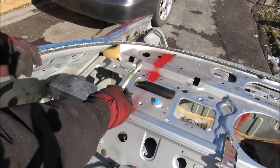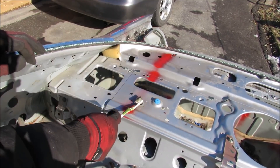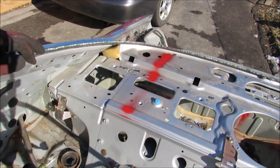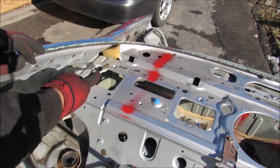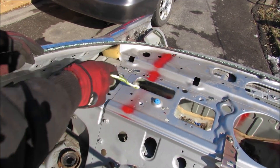When cutting up a car, the best parts to cut are the thinnest single layer of materials — for example in this region over here, as opposed to cutting along the strut mount area where there's very complicated geometry. You can also make use of any existing holes in the bodywork so you don't have to cut extra.